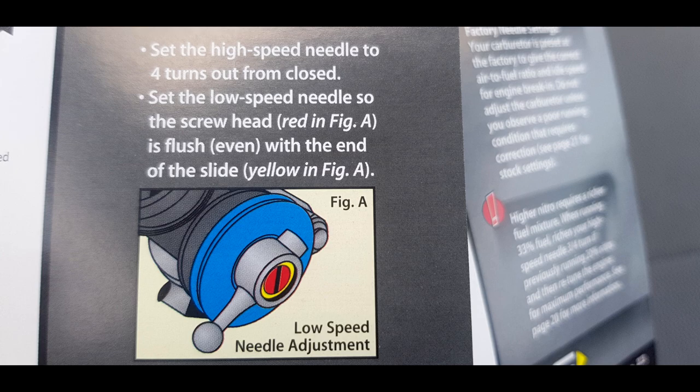The yellow circle that you see in the photo is the actual carburetor ring area, and then this is the screw. So you want the top of that screw to be flush with that yellow inner ring. All right, so